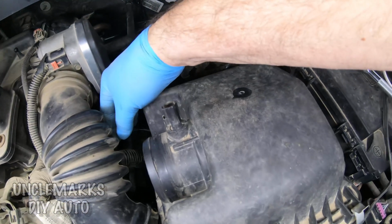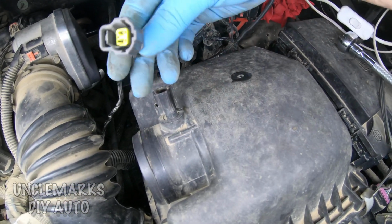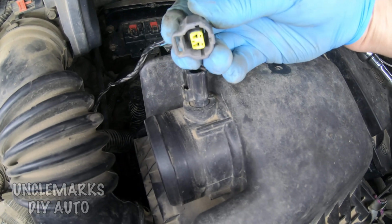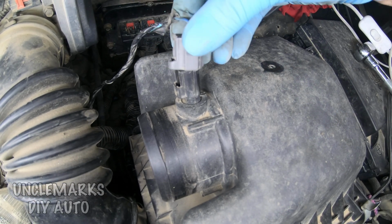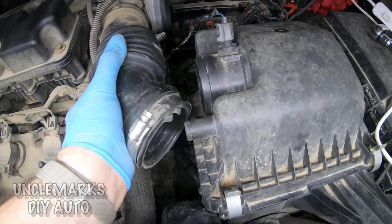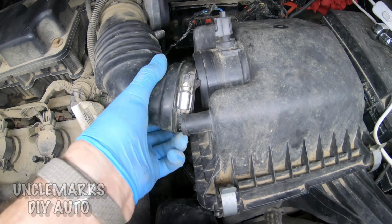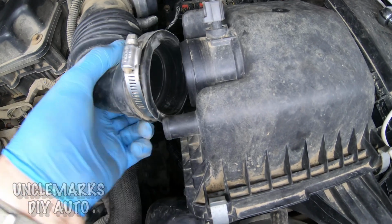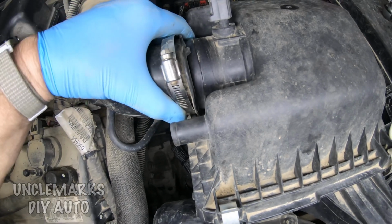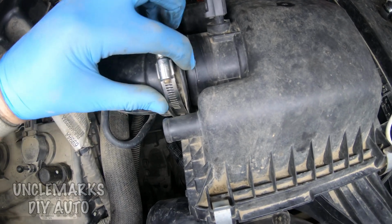Oh, yeah, let's hook these tubes back up. We've got this connector for whatever the sensor is. Either it's a mass airflow or a MAP sensor. I never looked it up to see what it was exactly, but that'll click in there. This air tube goes to your intake from this air box here. Again, two hands would be easier to unscrunch the hose.